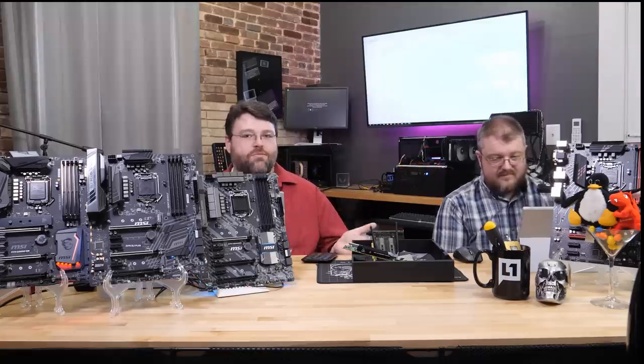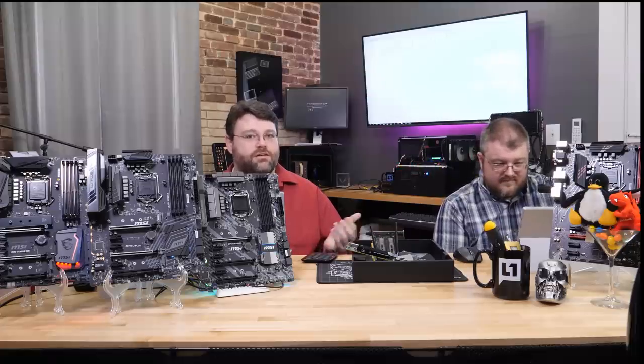What will be the temperature of the i5-8600K if I use an air cooler with a price maximum of around $75? Just keep an eye on your voltages. It probably won't be bad. Honestly, the Hyper 212 Evo from Cooler Master still does a really good job, even though it's an ancient CPU cooler that's available everywhere. I would be surprised if you have issues, because at stock voltages, Coffee Lake really doesn't get that hot. It's just when you add more voltage that it starts to produce a lot. It retains heat, I guess would be a better way to explain it.